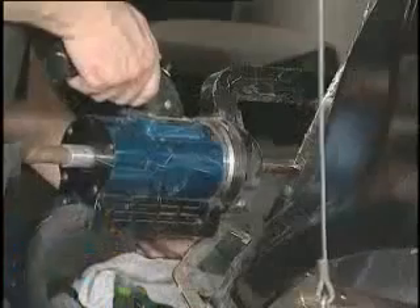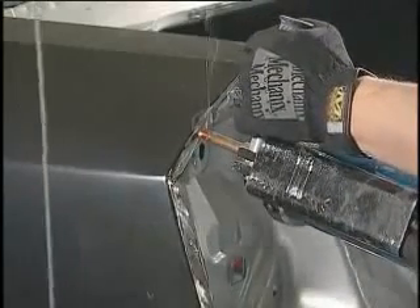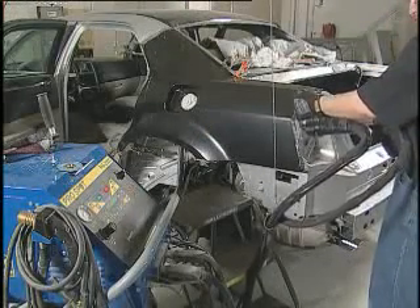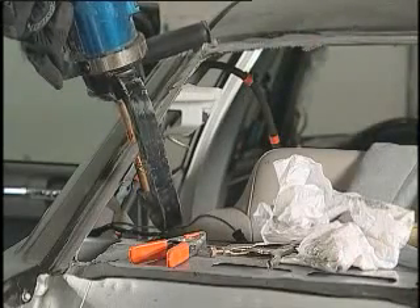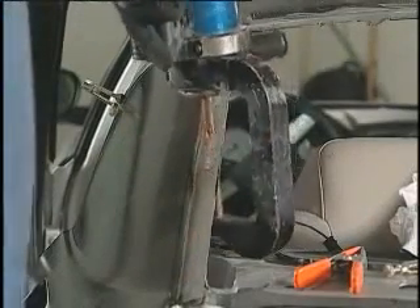Expect the adhesive to be a little tacky on the surface, as this is a normal property of the adhesive. You may begin welding immediately, any time during the adhesive cure process and or when the adhesive is fully cured. If a test sample through cured adhesive was not made, use the welder manufacturer's recommended settings for welding through cured adhesive. Once the first weld is made, continue welding, maintaining the original spot weld spacing.